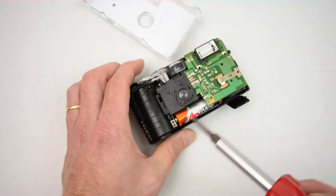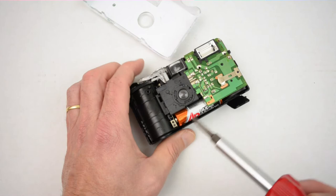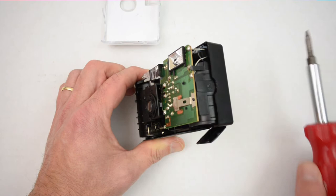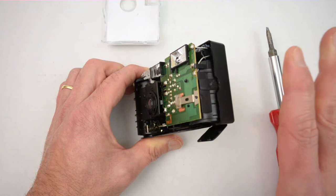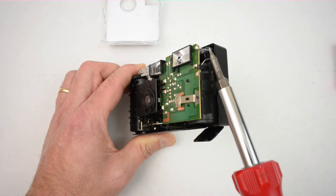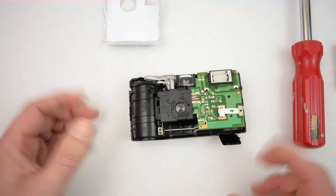It's going to crack open — there's your top. Here's your battery — pop your battery out first, and that's going to disengage your flash from working. It's not a bad idea to short the capacitor to make it safe to touch. Take something with a plastic handle and metal tip and go across those contacts. You might see a spark but that's okay as long as the battery is taken out first. Once shorted, it's safe to touch.